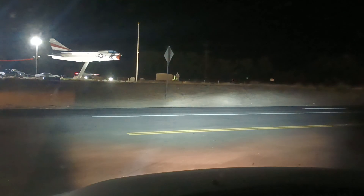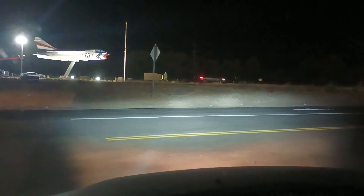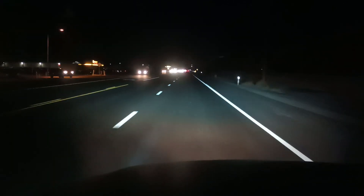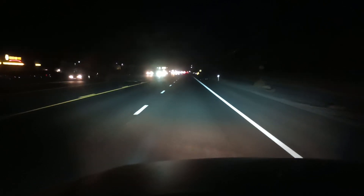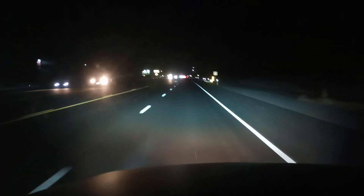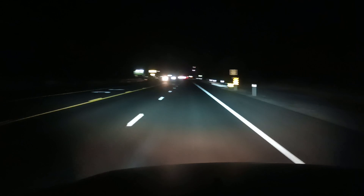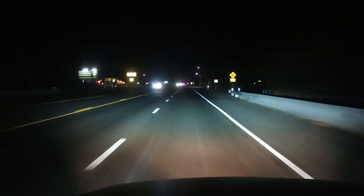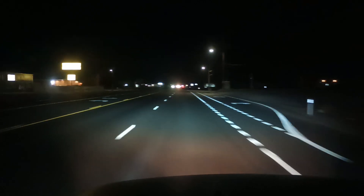There's the highs without the fogs, and here's the lows again. Now keep in mind those fog lights are halogen. Unfortunately on this vehicle — the '97-02 Expedition and the F-150s — I can't find an LED for the fog light because it installs sideways, so it's not clocked correctly and it won't throw the correct beam pattern. But these Philips Ultinon Sports are excellent lights.